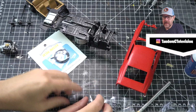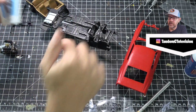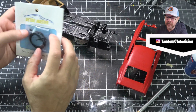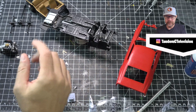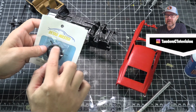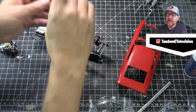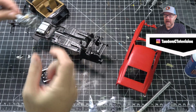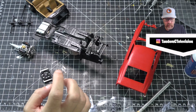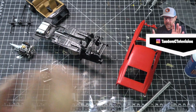So that's exciting to have that. I also went ahead and ordered, and we've talked about this, the 2-inch radiator hose for up top. But the fittings, I'll have to check again, have been out of stock. I can't find them anywhere. The fittings for this, the little AN looking fittings, are so that I can clean up the ends of where it plugs into the radiator and where it plugs into the thermostat, just to make a clean fit there. Those are out of stock, so I can't do it yet, but that's okay. I wanted to go ahead and order the hose so we have it on hand. It's ready to go, and we can put that in anytime. That's not a big deal.